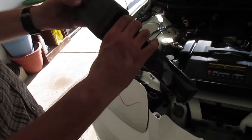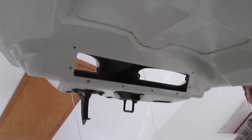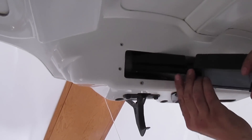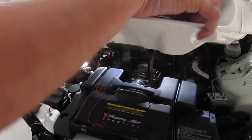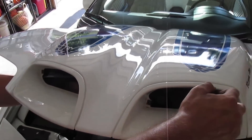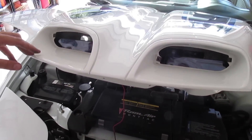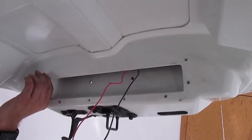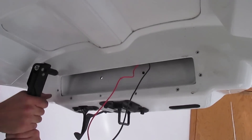The light mounts in the hood with the wires towards the top. You could go upside down, but the way the control box is staggered, you want wires on the top and nothing on the bottom. Feed it in from the back side and get the bolt to clear — the thing is flexible. First side in, then come around to the other side; have it come out the hole so you have enough room to get the second light bar in. Push it back in and it's inside the hole. Now get the back plate in — we've mounted it to the plate and riveted the plate in place. The back panel is back in place.